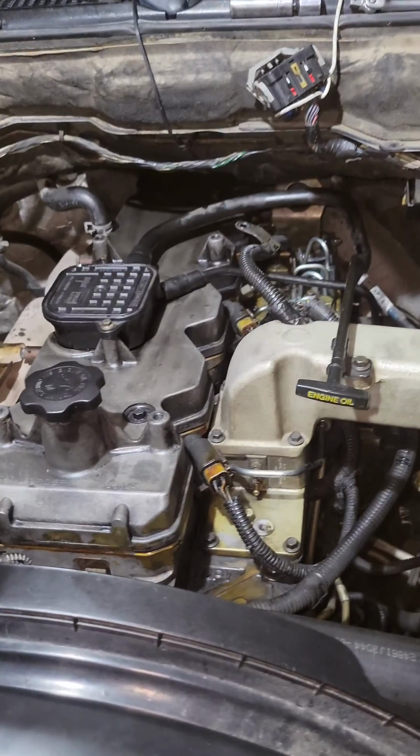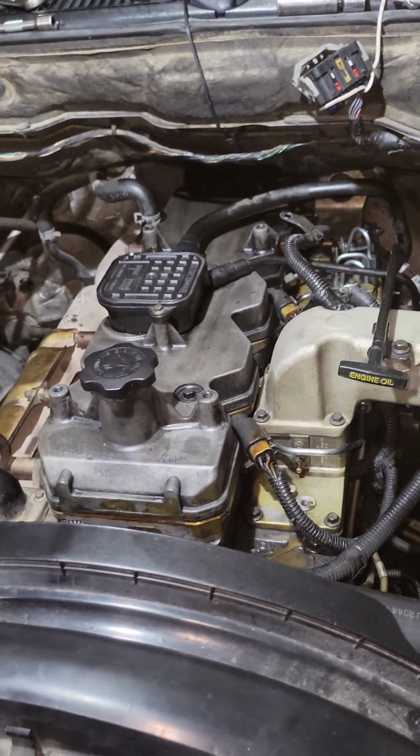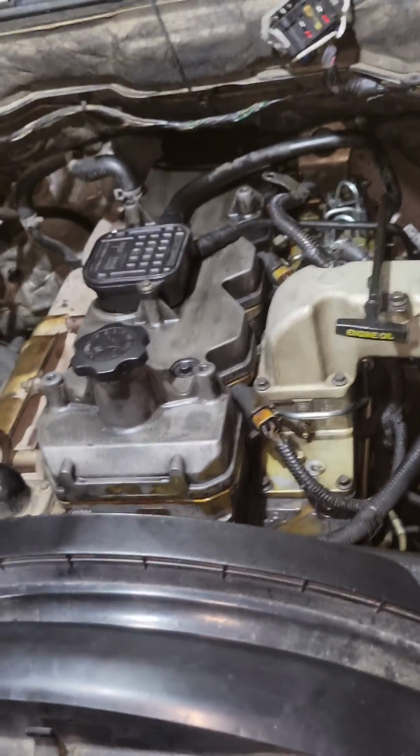And I still have another Power Stroke 6.0 that I need to pull the engine out of and also do a light rebuild on it. I already started speaking with that customer about pricing and all that. It has a misfire in cylinder 5. It has a dead hole. I'll show you how to do that compression test and do all that work.